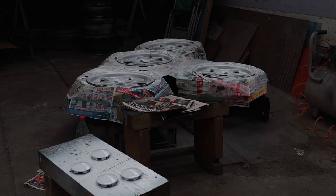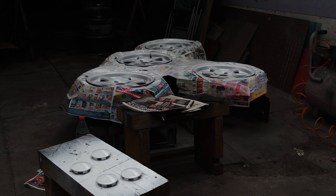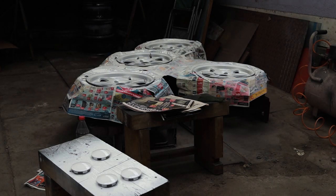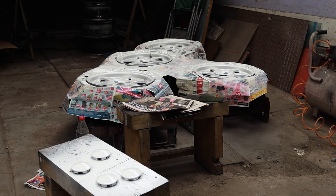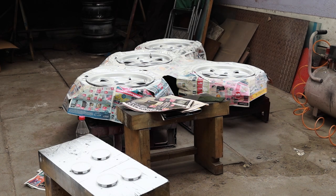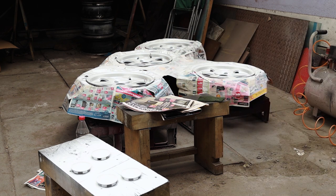Right guys, and as you can see, it's looking very, very different. Very bright, but very nice. So we gave it a nice thick dust coat, and now basically another very, very thick coat. As you saw, Shamil just went over it, getting in between all the spokes as well, because that's obviously very important. Nice tight edges. And how we do that, we normally adjust the fan on the gun a bit smaller so that you can of course get in between all the little areas.